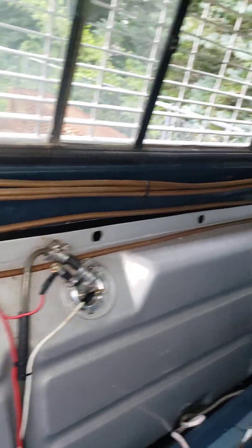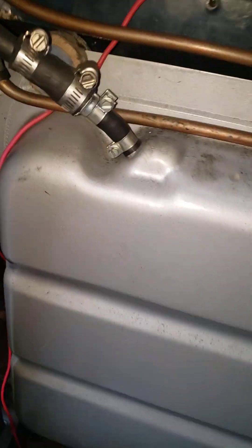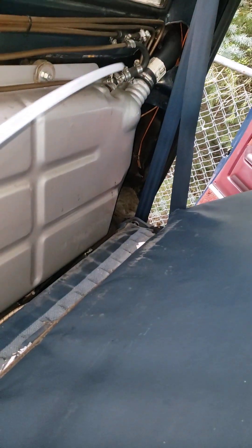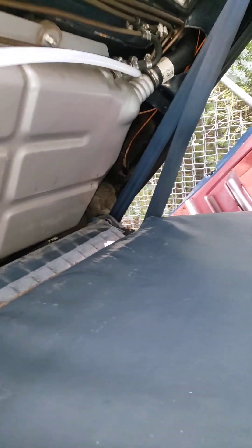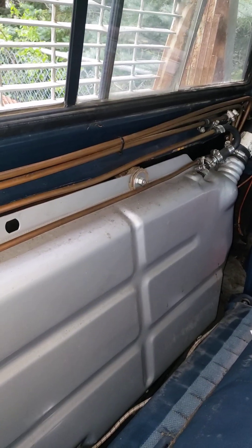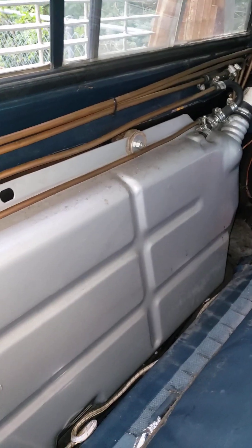It works great — I've had it in my garage and it doesn't vent at all. The main thing is, in a rollover, all my vent lines are run from one side of the tank to the other side of the tank. Even where I had to do a funky loop off the fill right here, there's one that goes all the way over and vents all the way back over there. In a side roll, there's no way any of this can go past the fuel tank.